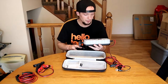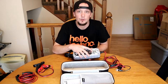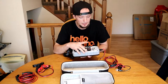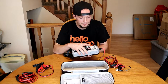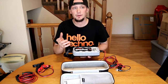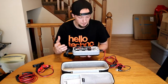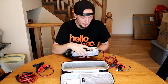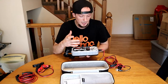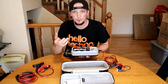This is the 7200, so it's a 7.2 amp or 7200 milliamp. It does 12-volt charging, it does 24-volt charging, it does AGM batteries, it does lithium batteries. It also does 12-volt repair — if you have a battery that's been sitting around for quite a while and you want to try to rebuild the cells, this charger says it can do it. It also has a 13.6-volt supply mode, which is a bit faster if you're trying to get a car charged up.